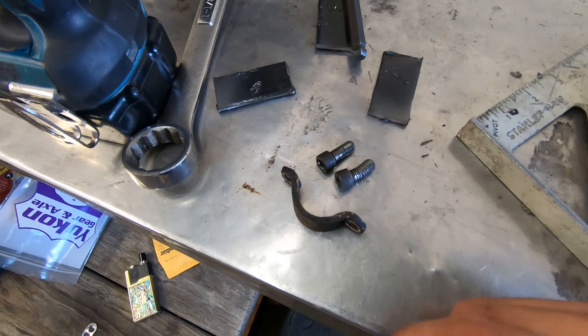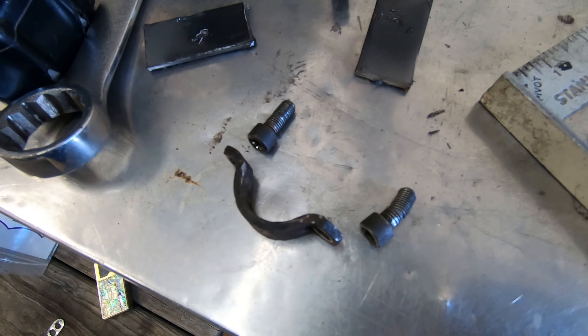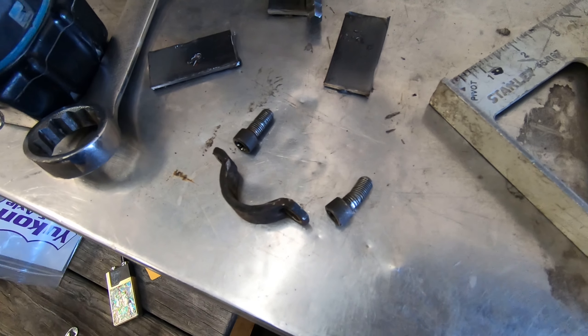We've got it all taken out. You can see what happened — two of these bolts started loosening up, and the other side thankfully didn't loosen up too much, so that held. On the highway I just started getting a wicked vibration, pulled over just in time. I thought it was my clutch — I have a dual mass clutch in here and I really shouldn't. I went underneath and didn't see anything at first, but when I pulled up a little, the driveshaft completely spit out. Thankfully I was only going one or two miles an hour on the side of the road and not 70 on the highway. It looks a lot better now — no hardware store bolt in it.